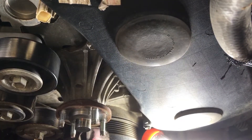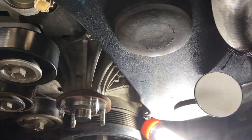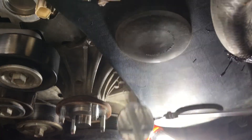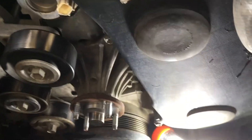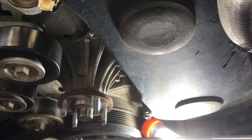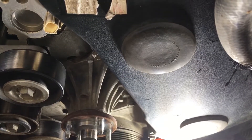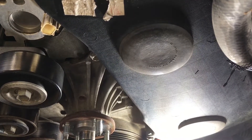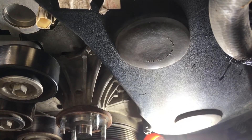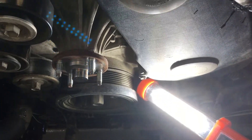You might want to consider at the timing belt change - not only the timing belt, maybe the idler, it needs to be checked, the tensioner maybe, the cam seal, obviously the water pump. Check out these bearings on this tensioner down the bottom - that's letting people down, costing people getting stuck with $1000 quotes because you've got to replace the whole tensioner. I've sourced this bearing, also the bearings in these idlers and the drive belt. So a bit of related work while you're in there - do the whole job. Also that lower hose down the bottom.